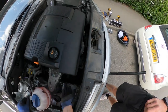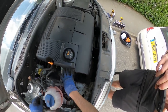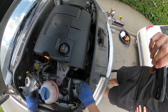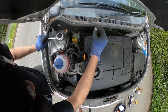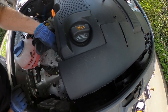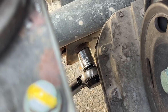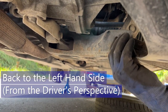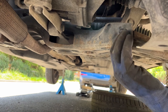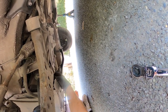Other guys on the internet suggest you can just jack up that side of the engine, and that's probably true, but we're not getting enough clearance, so we're just going to have to loosen this top engine mount to give it a little bit more movement on this side. Take the nut off. We can just about break the seal - it's an 18mm socket that one. On this side it's totally fine and quite straightforward. However these are extremely tight, so I'm going to use several extension bars to bring this out of the front of the vehicle and then use a breaker bar with an extension bar to undo it.